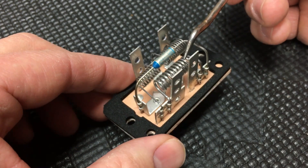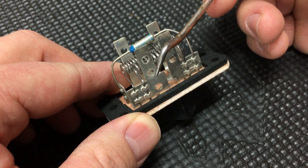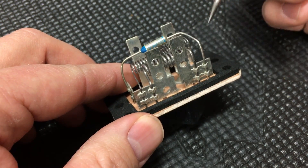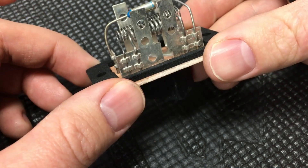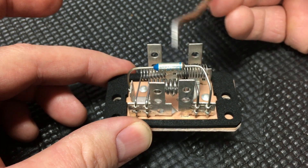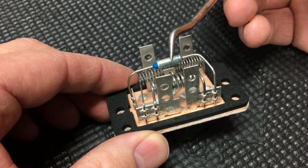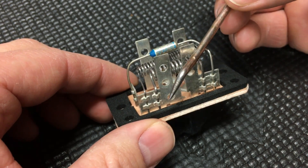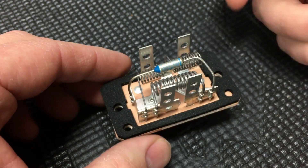Now there's one problem with it: it has a lot of exposed metal. You can see all this exposed metal — it may have some zinc coating on it, but it does not protect it very well. This thing gets bolted into the HVAC case so the blower motor air can pass over it and keep it cool and reliable. The problem is that there's a lot of condensation inside the HVAC case — humidity, different temperatures — and all that water vapor condensates on these metal parts, thereby corroding them.